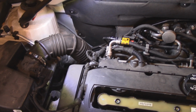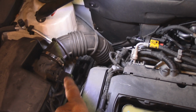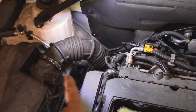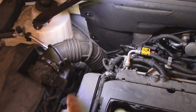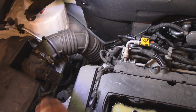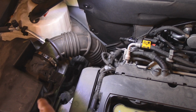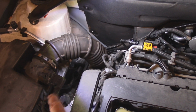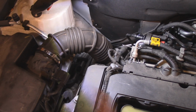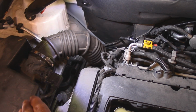And I'm going, well, you know what? I think you had 2 problems. One was the dirty mass air flow sensor, and you clean that with mass air flow sensor fluid. Now, I didn't, but you really should, because I don't want anybody complaining that you used the wrong fluid and they're driving a McLaren or a Bentley or a Ferrari, and they just wrecked a $2,000 mass airflow sensor. So use the fluid, mass airflow sensor cleaner. Only takes 2 seconds. You just spray it down a little bit, and that's it.